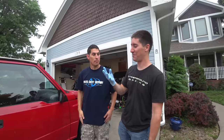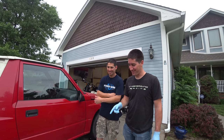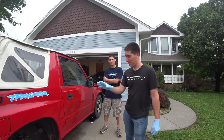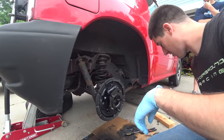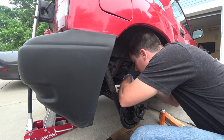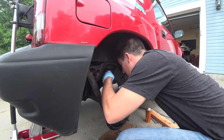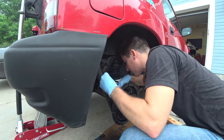You have grease all the way down your neck — like four stripes of grease. So let's just be clear about who did the work here. We had to go get wheel cylinders because we decided this one's blown out, so let's just replace them both. When we went to the store, Gabe cleaned all this up and painted it because I'd painted the other hub — we wanted them to look nice and black. He got it all knocked out and it looks beautiful. So now I just have to hop in here with my flare wrench and get our brake lines off. These things are on there, and man, are they squirting out brake fluid — it's going to ruin all the paint. I think we made some progress there — that one's out. Now for the bottom one.